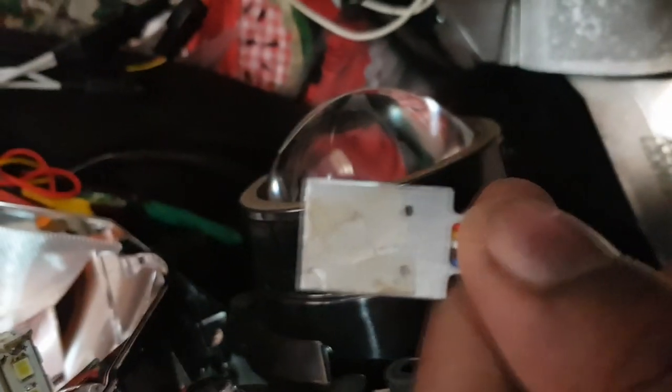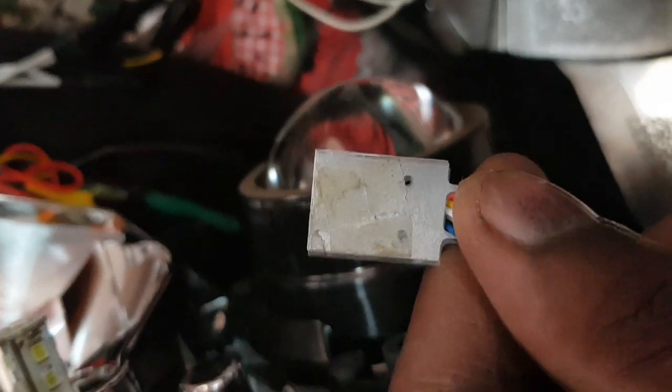2 days have passed since I did the headlight install on the driver's side. I had figured I'd wait a few days to see if anything would show up, mistakes, or if it would stop working, which of course somehow it did. The demon eye fell off, so the use of double-sided tape clearly failed me. And I'll advise you don't use double-sided tape for anything to hold the demon eye or the halo ring. They are going to fail.